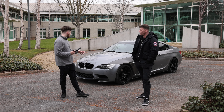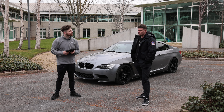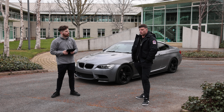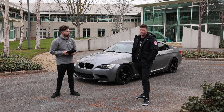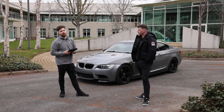Have you had any major problems with it? Any big things to look out for when buying these types of cars? On the three-litres, there's not a lot of problems to look for. On the N47s, there's quite a lot — especially the timing chains, as we all know. But on the three-litres, I wouldn't worry. There are a lot of good cars out there. You just need to look at the gearboxes depending on whether you're going auto or manual, as some of them can vary.